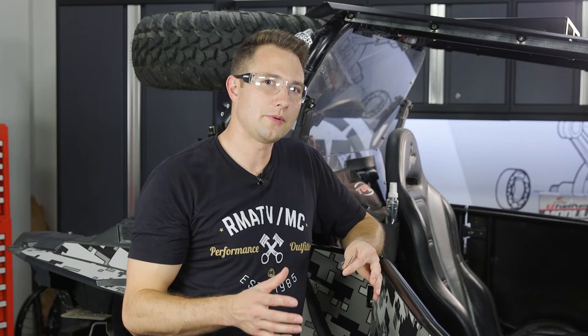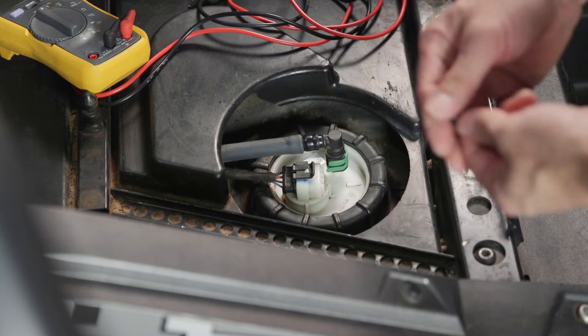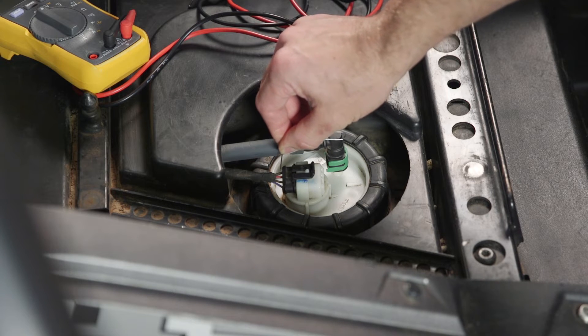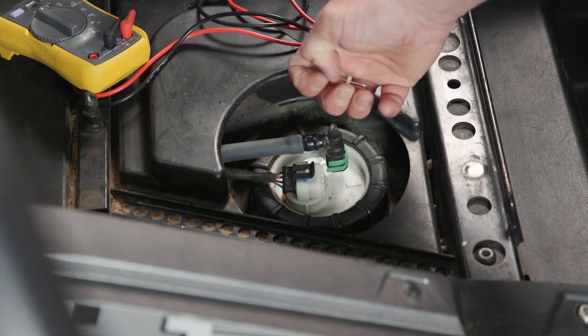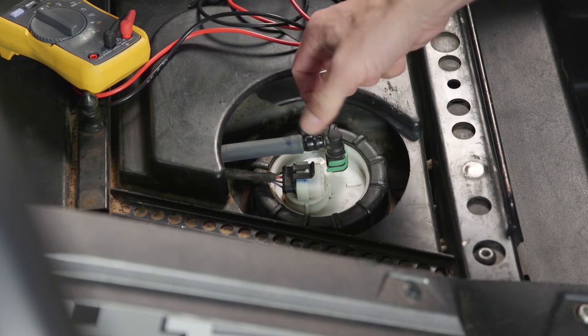Going back to the beginning — for those of you whose fuel pump didn't even cycle — we're going to test that now by checking for power coming down to it. This is where you'll need your paper clips and digital multimeter. This is the connector giving power to our fuel pump. The red wire with the blue tracer is our number three terminal, and the brown wire just to the side is the number four terminal. We're going to back-probe those two wires to check for power. We don't want to probe the front side of the connector because it could damage it.